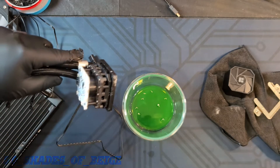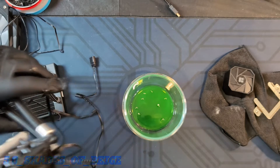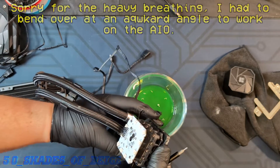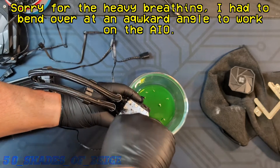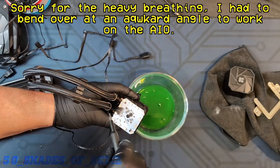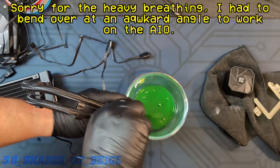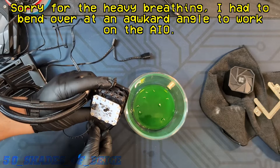I'm sure my wife will be very pleased to smell coolant everywhere when she comes home. Looks like we've got two tiny screws here — maybe a Phillips zero. I apologize if I'm not getting the best angles; this is really awkward to do while everything's connected. I'll go ahead and pull this off. Be mindful because it looks like the power for the pump and the LEDs is just soldered on here, so you want to be careful not to disturb those solder joints too much.